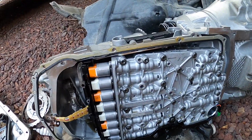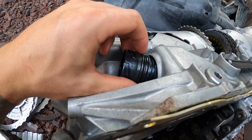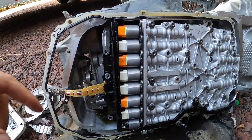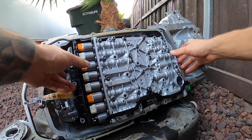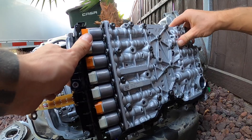Alright, well I got everything pretty much free. I'm just figuring stuff out. So this has to come out. You kind of have to pull up this retaining tab — you have to pull this out in order to get the plug connector out of here. And then there's another sensor there for output shaft speed which is roasted, but she should be free now and it's out.